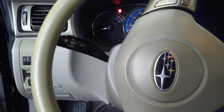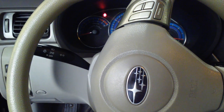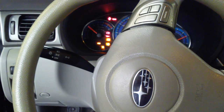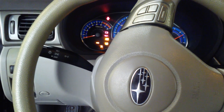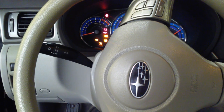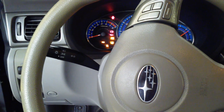We're back after 20 minutes — let's do part two. You can see that's where she should be idling — that's perfect. Now shut it off. Let it sit for a couple seconds, put the key back in, let it sit for 15 seconds again, and then start it. Key on — not starting yet — that's the second part. Then run it for 10 minutes.